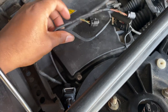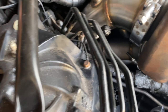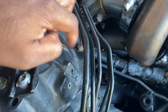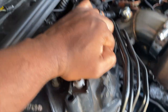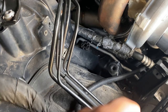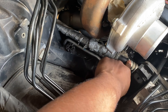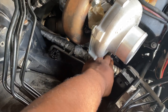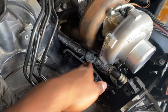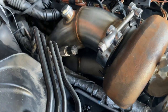Down here I have the Motive boost box sitting by the DME. I have a ground for it but I think it's a bad ground, so I'm going to find a new one over here. The main thing now is I need to rewrap this whole line with some heat protection sleeving and tuck it up a bit more with the cover wrapped over it.